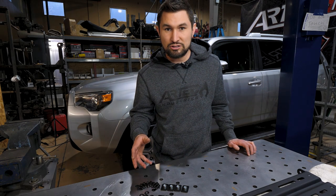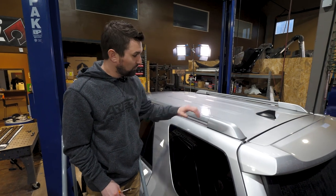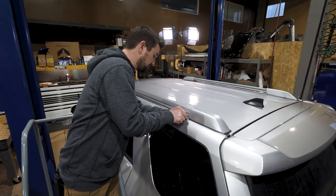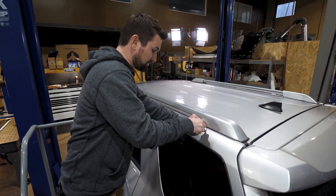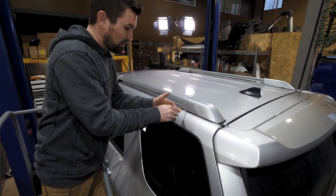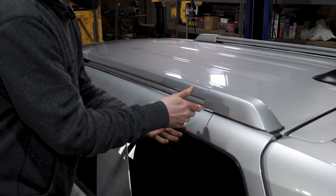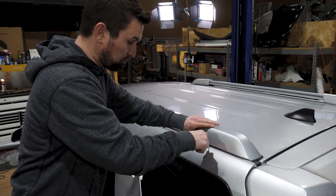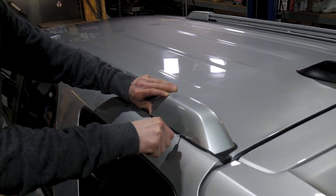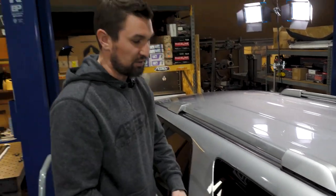All right, let's get these on and show you how to install our roof rack — it's super easy. The first step is to remove the four factory caps for the factory roof rail. If you've never popped these off before, there's a few things you want to pay attention to. You want to stay away from the paint here. A lot of people like to use the drywall spatula, but I think you run more of a risk of damaging the side of your 4Runner and the paint. So I like to use what I call the pick method, where you just fish your pick in and pop the little tabs on the inside.